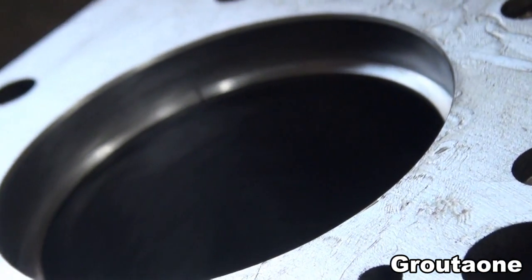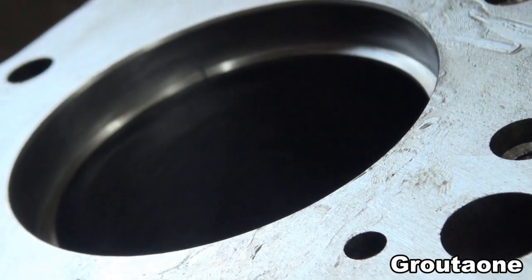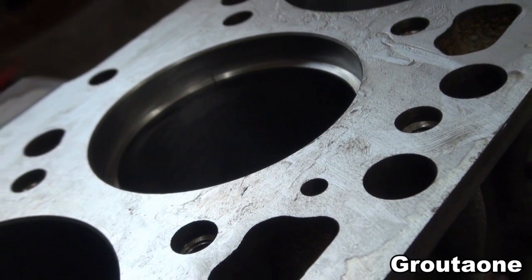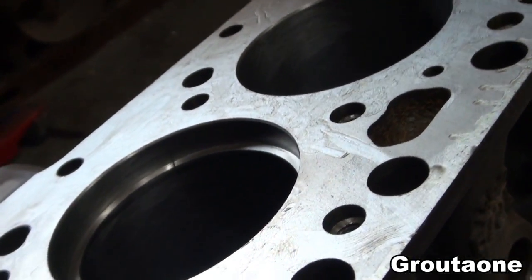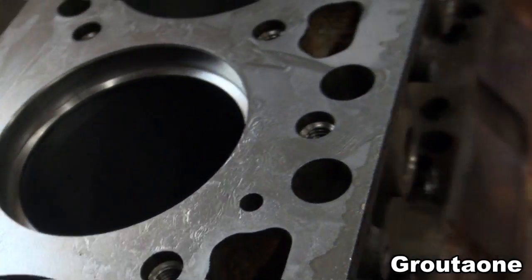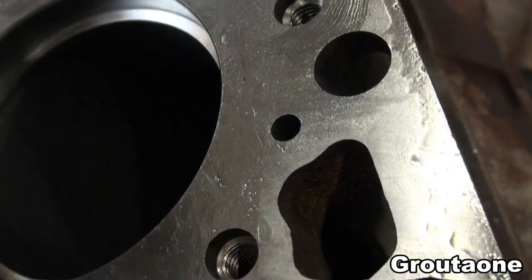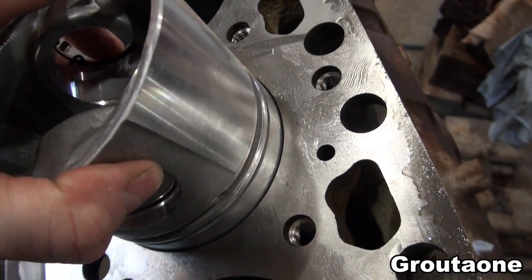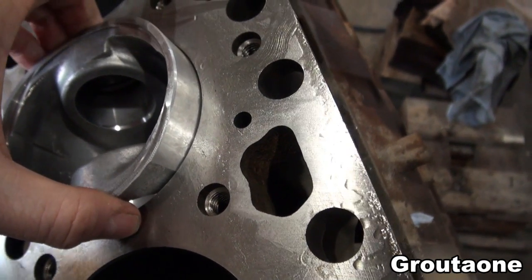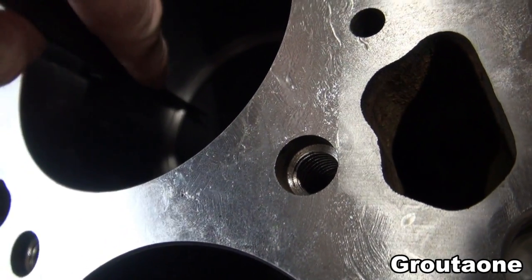This block has a very slight ridge at the top of the cylinders, so the cylinder will be worn bigger at the top than at the bottom. I'm checking one of the rings more towards the top where it would be worn slightly bigger. I couldn't get 18 thou in there, but I could get 17 thou. I then slid the ring further towards the bottom to see if that makes a difference — and 17 thou still goes in there.